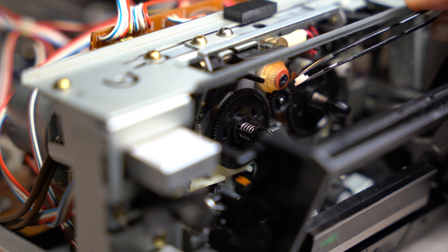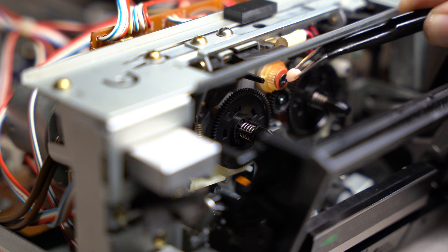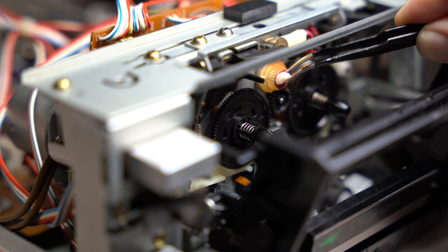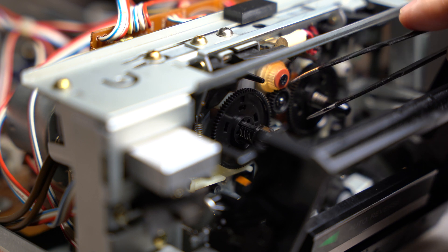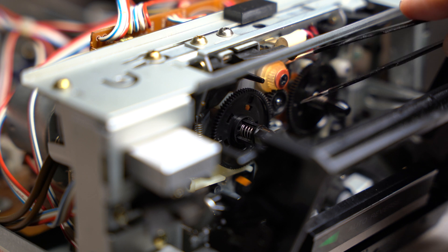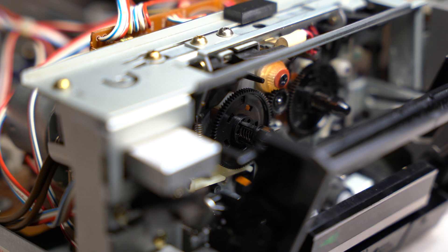The problem was that this small part had a shaft which had been held together as a friction mechanism. Due to aging, the plastic became very brittle and crusty, and it just fell out because there is a spring installed for the friction. I had to drill out the rest of the shaft from this plastic piece and install a screw with a ring. Now everything works smoothly and friction is enough to pull tape during playback in each direction. That was the reason that tape friction and tension was not good enough.